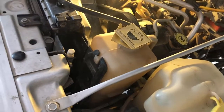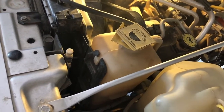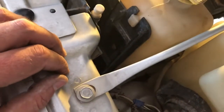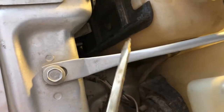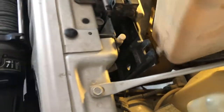There are four bolts that hold the fan shroud on — two down below, two up top. I already took off one down below on the passenger side; the driver's side is a little tighter to get to. I think the easiest way to get to it is to remove the overflow tank, which is pretty easy. There's a little nipple in the bottle right down in the bracket — I slipped a flat blade screwdriver in here, pried a little bit, pulled up on the container, and it came right out. Unhooked the hose from the radiator overflow and set that aside. Now I've got pretty good access to that lower bolt.